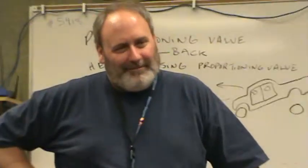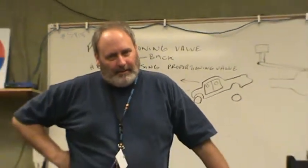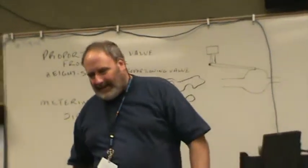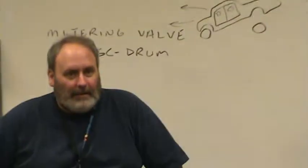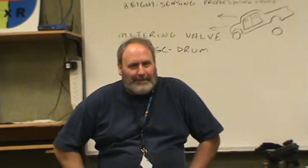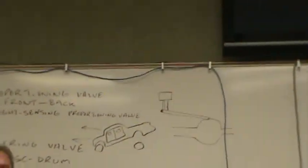Teacher, it's a problem when you are confused, you put it in the reservoir, the brake fluid, you put it in the steering. Oh, yeah, because that's oil. Power steering fluid is oil. That's petroleum products. That means you got to replace all the rubber in the system. More dangerous than water? Super dangerous. Yeah, because it makes all the rubber swell. Okay. Petroleum is what swells. The last time I saw one customer, everything, the brake, everything is packed. We replace all with the stuff.